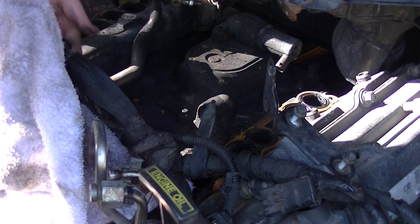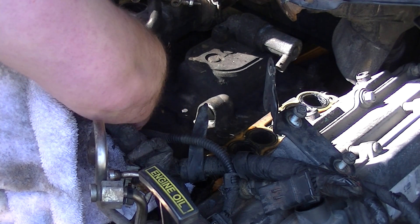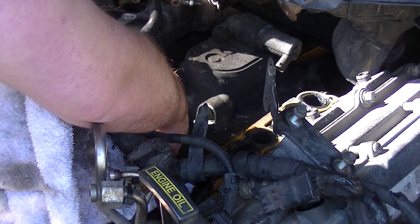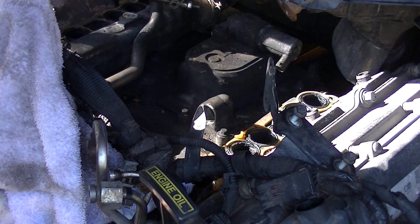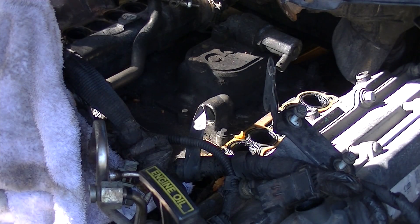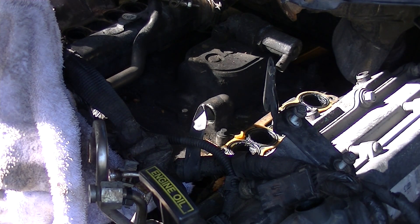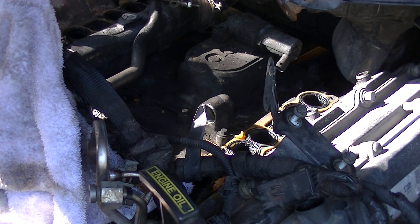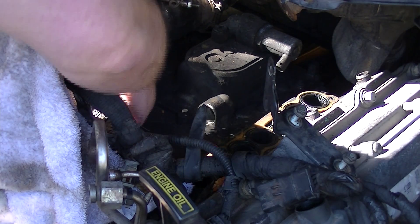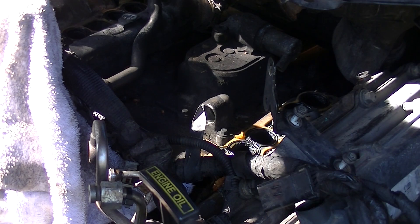What the hell kind of clamp is that? It's not even a clamp — it's just a band. Again, I think the previous owner gave me a line of crap when he said the EGR cooler had been changed out on this; I'm beginning to feel that way. Everything's loose here. I'm thinking I'm just going to cut that — I want to make sure I'm not going to drop coolant down inside anything. It doesn't look like it; I'll stuff a rag up underneath there to try to catch some of that. I'm not feeling any method of removal — this might just be a stretch-it-till-it-breaks type deal. I'll just cut it out.